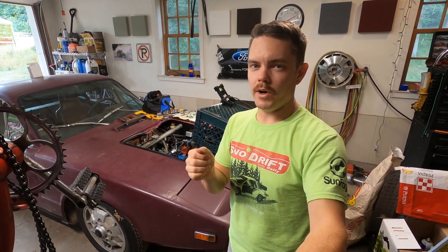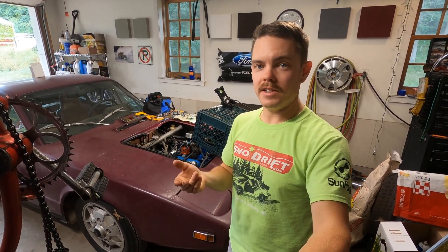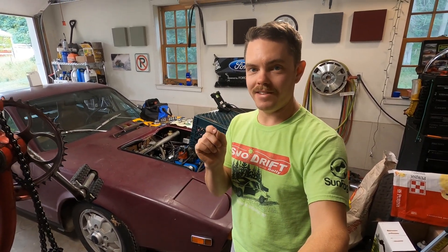I've confirmed two things. One is that when I had a breakdown in a previous episode — link in the description — I swapped in the new Saab 99 condenser and the car ran perfectly all the way home, but it wasn't a correct fit and wouldn't stay in long. The second thing is that the new old stock condenser I had in the car did not test well — very inconsistent readings — so I'm calling that an internal short. I'm going to combine both condensers into one working one.